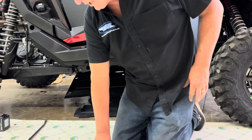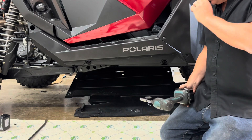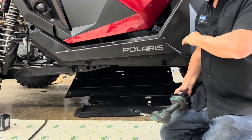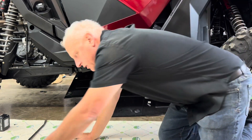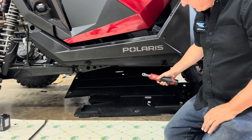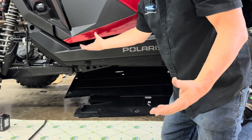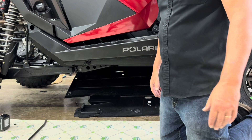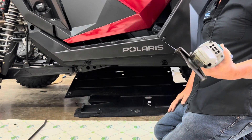The tools we're going to need is a 10 millimeter impact gun. Take the skid plate off right from the get-go — get it out of your way, be done with it. You're going to need a 14 millimeter wrench in order to get inside there once you drop the skid plate. You're going to need a Torx bit — maybe. I took off some of the bolts on the rockers, don't know if you need to. You need some type of grinder, even a knife will probably work.